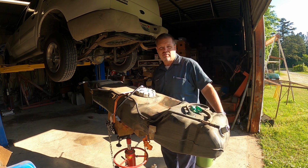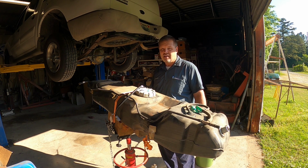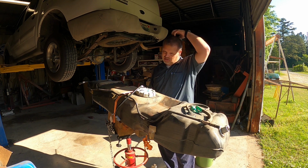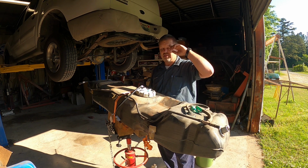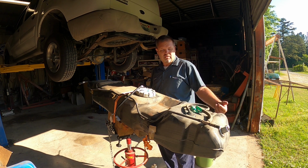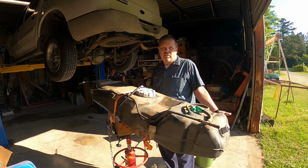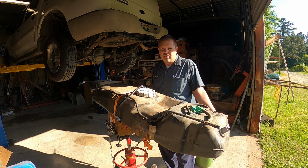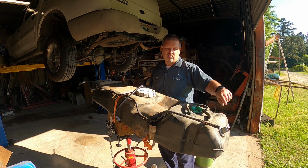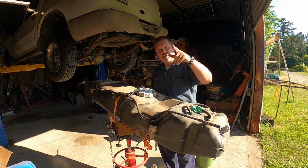It's like forward thought of, ever having to take the fuel pump out. Will it do it a second time? I don't know. I'm gonna put a little Vaseline on this when I put it on, so maybe I can get it off again later, because the hose clamp will hold it. It ain't coming off even with any kind of grease or petroleum jelly, whatever you want to use. It's not going to just pop off with a clamp on it, not with this lip on here. So let me get everything set up, and I'll get back with y'all in just a minute.